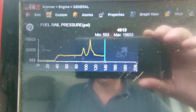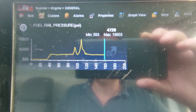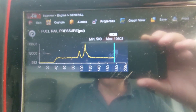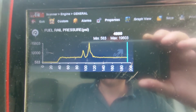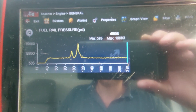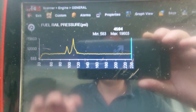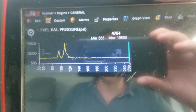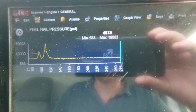So that's all solved. This was a complete non-start. We had the fuel pressure codes saying circuit low. The sensor was shorted internally, pulling it down to ground. We did the bypass test with the decade box, confirmed it, then got a new sensor — and yep, we're all good. We're started and running. We'll take it out for a quick test drive and that should be it. Thanks for watching and come along for the next one. Cheers.